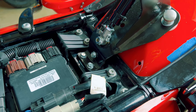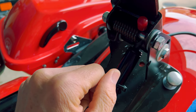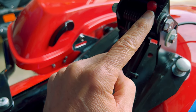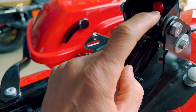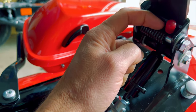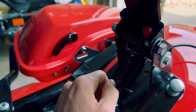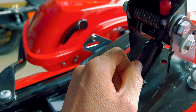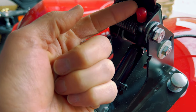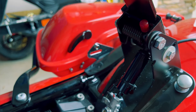You clip it in place and zip tie it, and now you're done — it's completely mounted to the bike. One thing I want to throw out there: I added extra rubber to the top of the spring. The metal from the end of the spring stuck out a little bit, and that could possibly rub on part of the seat at some point. So I took a little piece of rubber — actually just from a battery post — put a screwdriver behind the spring a little bit, worked the tip forward, and slid this rubber grommet over the top of it. You can put anything you want on it; some people cut it off with a Dremel tool. I just added the rubber tip to protect any part of the seat.